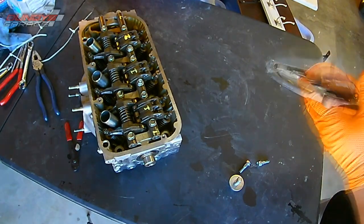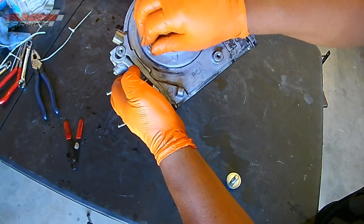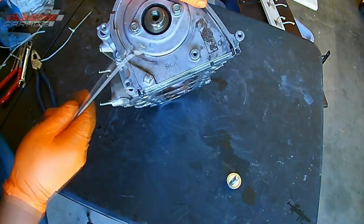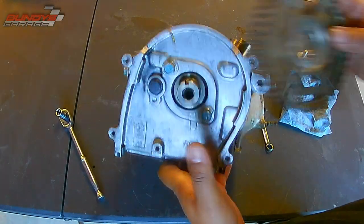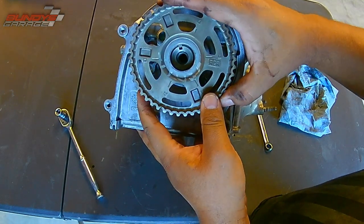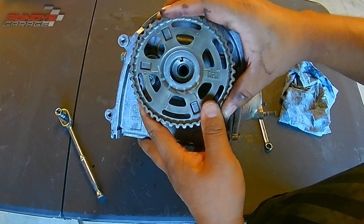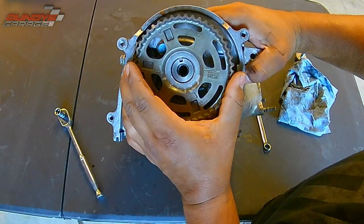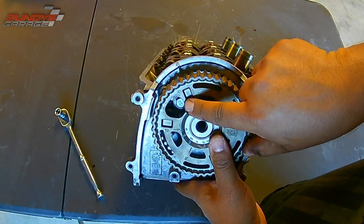So here next I'm going to put on the cam gear. There's a backing plate — you have 12-millimeter bolts that hold that in. The camshaft has a little notch, and that notch correlates to a notch on the sprocket. The timing belt goes around that sprocket. So I'm pointing that notch out — it only lines up one way so you can't get it wrong. On the end of the camshaft there's a notch, and on the cam gear sprocket there's a keyway, and it only lines up one way.